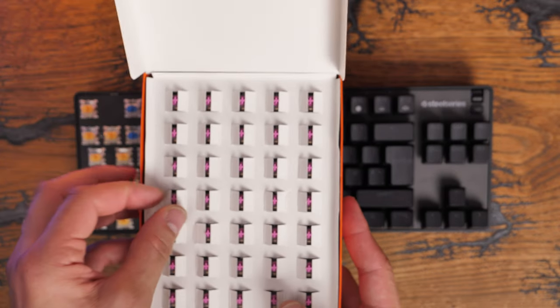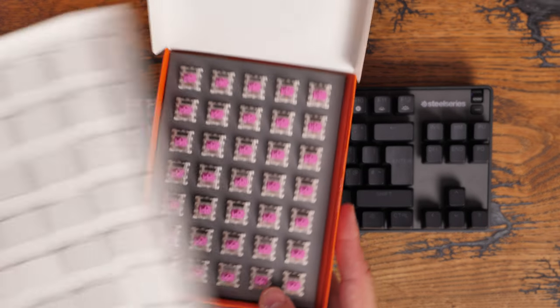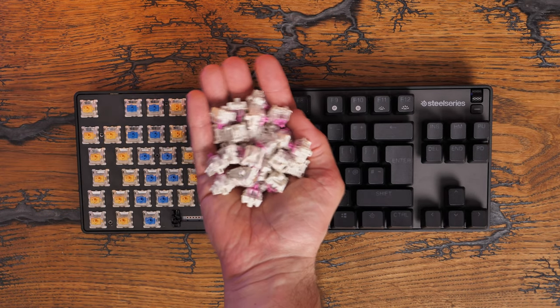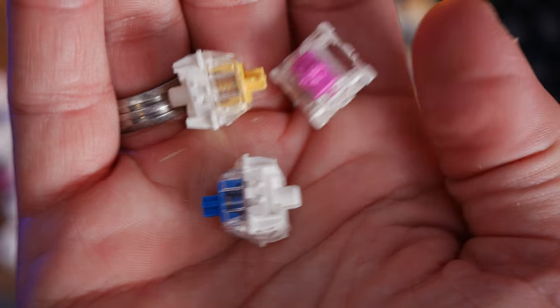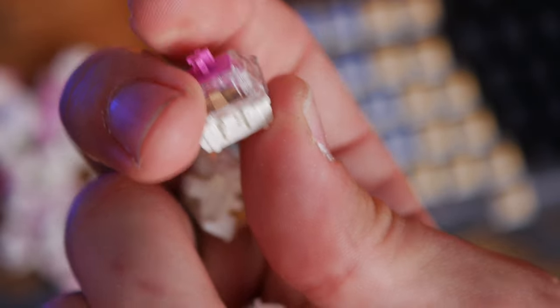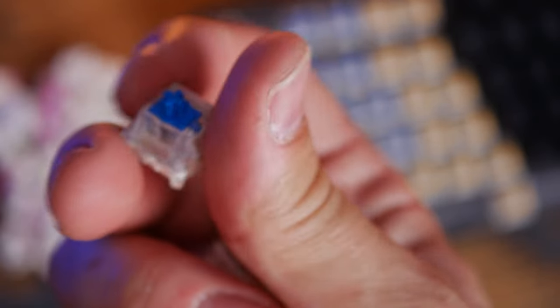And obviously you have a choice of three different switch setups in here. Now you can see the pink switches, and these are the tactile ones. Again, they have a heavier actuation force than the linear switches at 55 grams, and the distance that they can travel is more as well. I'll leave all the specs in the description so you can find out more, but they are quieter than the blues. So they do give a good experience still and a more tactile response when you're pressing them. And you'll hear the sound test at the end show off what they sound like in the keyboard. But even on their own outside the keyboard, you can hear the loudness of those blue clickies by comparison.